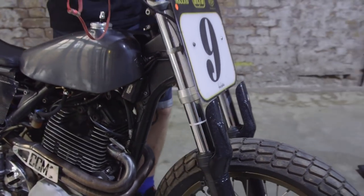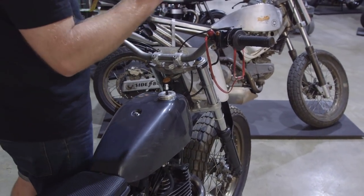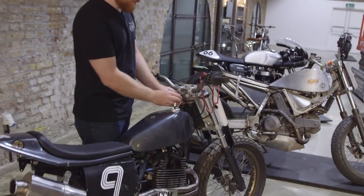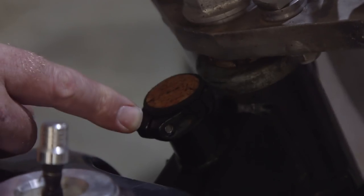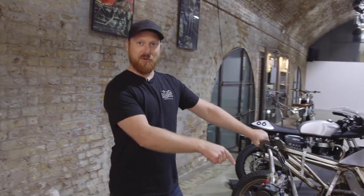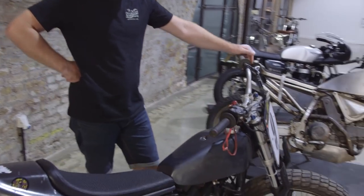He makes these himself. Most people go for the conventional fork conversion, just lower the bike. The upside-downers are not only a little bit stiffly sprung and more difficult in terms of having to lower them, but you get less steering lock. I run a little bit more than most people, and I'll let you into a little secret here. I spent two hours making a special magnetic rubberised plug to go down the oil filler, then made a champagne cork and BMX seat post clamp plug for the top. Got to the first race and was proudly showing Ross Herrod my thing - and he said, why didn't you just notch the yoke out and use the original filler neck as a lock stop? But you live and learn.